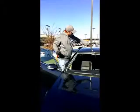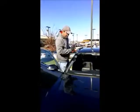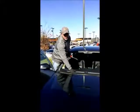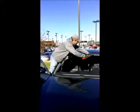Now what we're going to do is cut off the existing urethane bead and get it cleaned up and run our urethane bead over the top of the old one that we've trimmed down, and then we'll prime it and toss it with the mat.